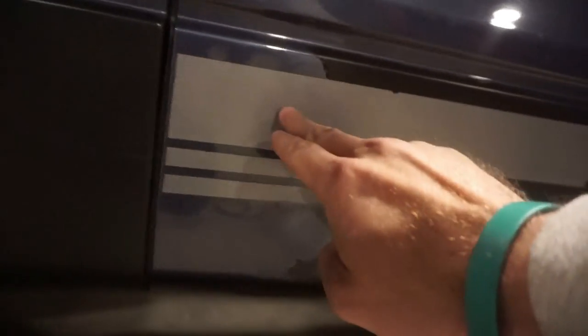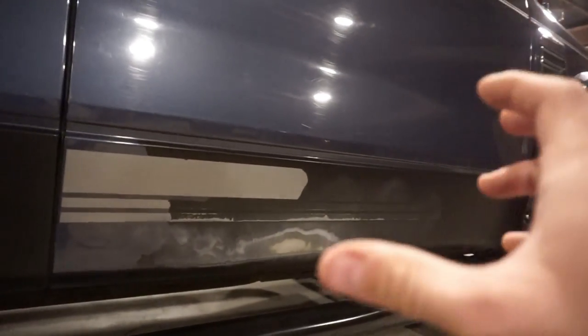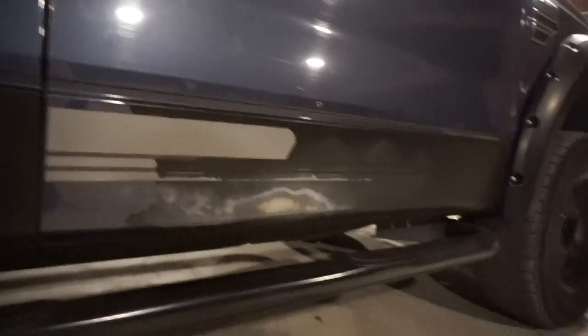Now, instead of going through the super tedious process of peeling off all the Plasti-Dip little by little, I'm going to go ahead, as you can see, I've already started. I am just sanding down from the Plasti-Dip right into the body of the truck. I tried to start peeling it off a little bit right here, but I decided that would be way too time consuming. I've got a handy orbital sander right there, and so I'm just sanding from on top of the Plasti-Dip right through. It's not gumming up the sandpaper, so don't worry about that. It's nice and dry because it's been on there for a long time, so I'm just sanding right through it, right onto the body of the truck, and we're going to be repeating that process all the way around this side. We're going to be doing the back bumper, the front bumper, and the other side of the truck.